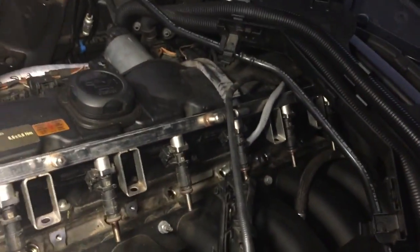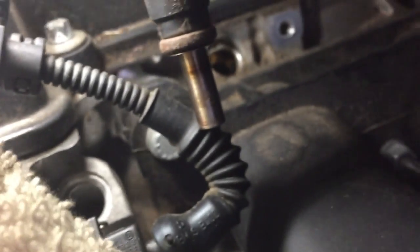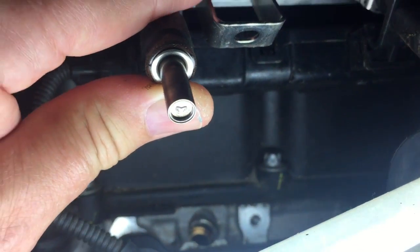Now we're just going to wiggle it out and get them up so we can inspect them and give them a clean. To lift that rail up, you can see here, just very careful of the tips as I did that. But I'm looking and I'm seeing a lot of burn marks and lacquer and all sorts and far from clean. When I tip it over, the points actually look okay. I can rock that over and have a look now.